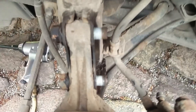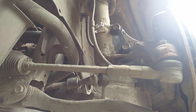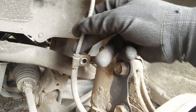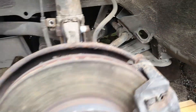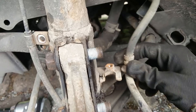Once you've done that, the next thing you'll need to do to remove the strut itself is undo the ABS cable from the strut. It was just, I think, 10mm. Remove that, and on the other side there's also the brake line connected to the shock, which you need to remove. So just take that out of the way, and with that done, we can continue.